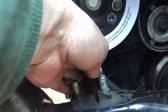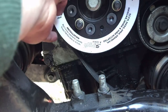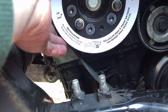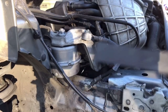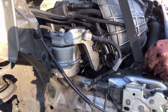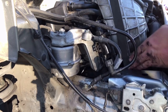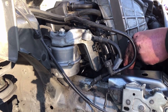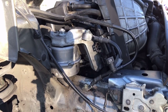Reroute your serpentine belt. I'm going to replace mine later when I do the supercharger pulley, but I'd recommend replacing it right now if you haven't recently. Put your belt tensioner tool back in, get enough tension off it to pull that pin out, then release it as slowly as you can.